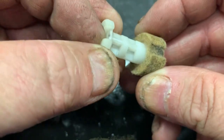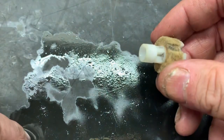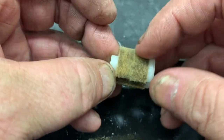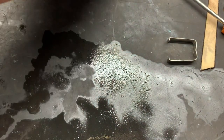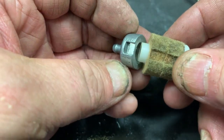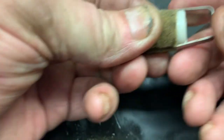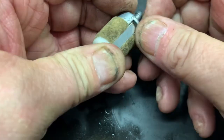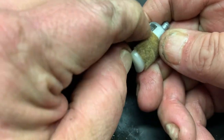To reassemble, just line up with the groove here and the groove there. This portion of the filter really doesn't stop up that much — it's pretty porous. But like I said, the filter screen is what normally stops up on these filters. So just go ahead and slide your filter base on, then slide the retaining clip down, clip it in, and then press down right here on this hump and you can get it to clip in that way.